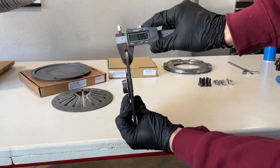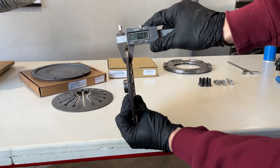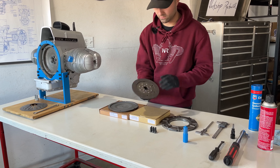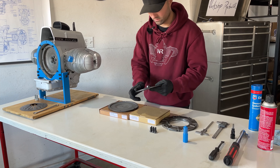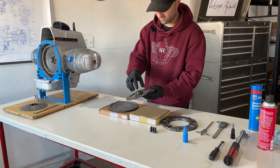After cleaning, we'll check the clutch spring diaphragm height with a depth gauge, aiming for 17.5 millimeters plus or minus half a millimeter. The measurement shows exactly 18 millimeters, which is within the acceptable range, indicating the spring's longevity. This can also be checked with a vernier caliper if needed.